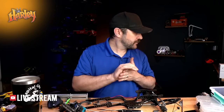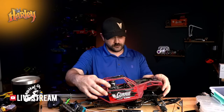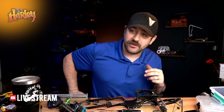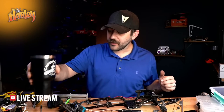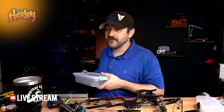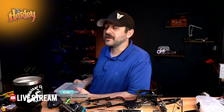Okay, rear links. So I am substantially longer than the front links that Wet suggested. But we're gonna game plan to be similar. What's in the cup? Cold brew coffee. Now being long rear links with a nice bend or two in them for clearance. Yeah, I think that's good, and you said, let's see, 162 millimeter rear lower, or upper, 176 millimeter upper.